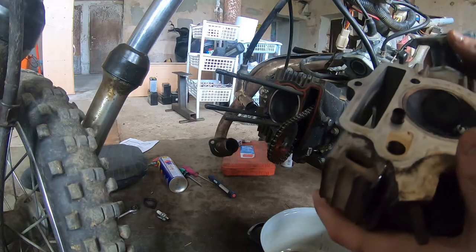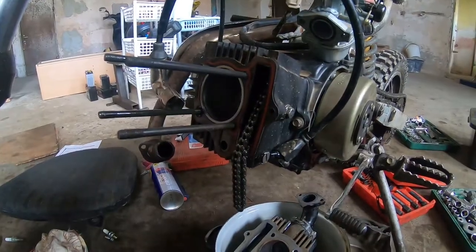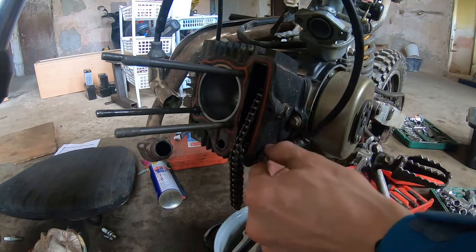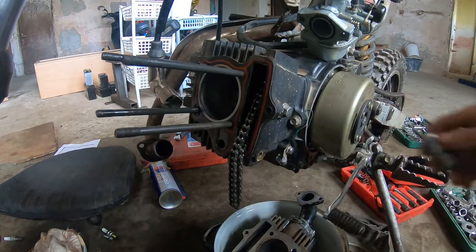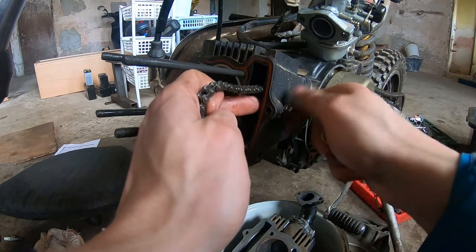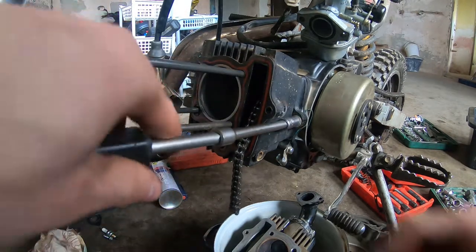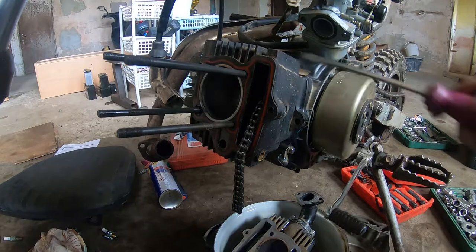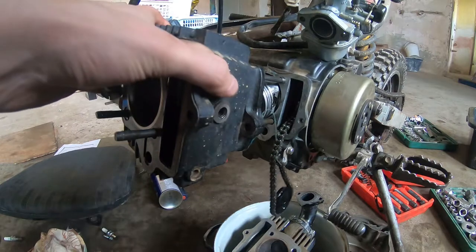From where I can see it looks normal. A bit carboned up but that's the usual thing. Now to remove the piston there's some kind of ground strap hooked to the side of the engine here, so let's get that out of our way. Let's take this idle wheel off — there is a little idle wheel inside this. And also let's take off this 8 millimeter here. I can see a bunch of silicone and yes, I can see our problem right now.